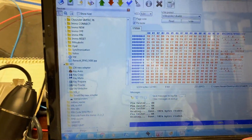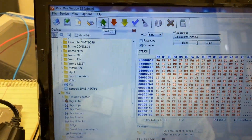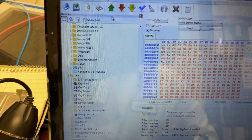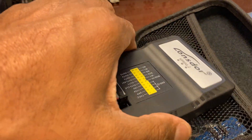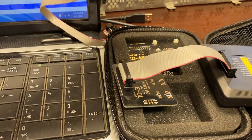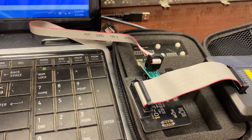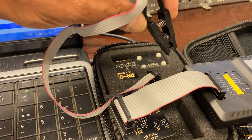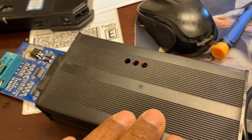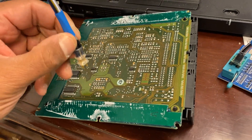When you open the binary file and read it, you're gonna click Read. You can use iBrute or any EPROM reader — it doesn't matter which one. You can also use your Lancer if it comes with this clip connector right here. You're gonna clip it on and use it in-circuit. If you have an iBrute like this, you can go ahead and read it with the quick connect that comes with the iBrute and plug it over.